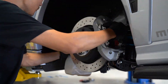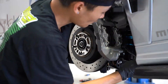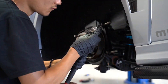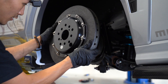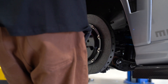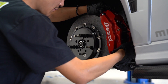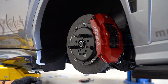I would also like to note that the rear dust covers do need to be either removed or modified to be able to fit the larger rotors. Now that our bracket has been installed, we can go ahead and put on our rotor. Now that our rotor is on, bleeder side up, mount the caliper. And just like that, caliper is on.